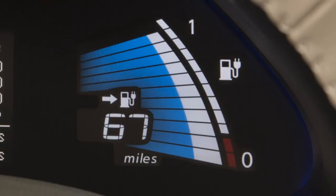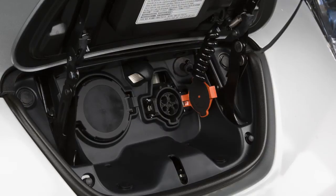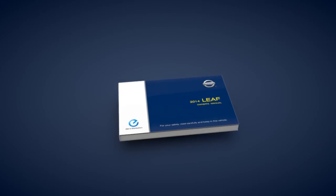There are three charging status indicator lights on the dashboard that can be seen from inside or outside the vehicle. These lights indicate the current charging status of the lithium-ion battery. If the vehicle is not charging, the lights will not illuminate. If 80% of a timer charge or 90% of a quick charge is completed, or if the lithium-ion battery is fully charged, all three indicator lights will illuminate. They will automatically turn off after approximately five minutes or when the charge connector is removed from the charge port.